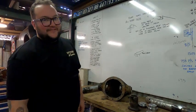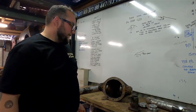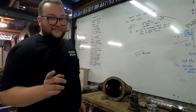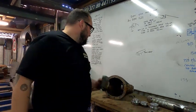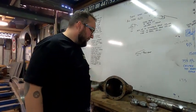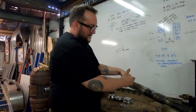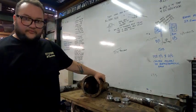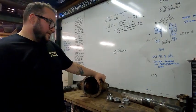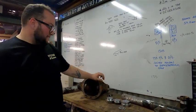He was actually going to use it as a jig to set diff width for a car. Anyway, he doesn't need it anymore. That's what he thinks anyway, so don't tell him. Well, it's not going back now. No, we've taken it off him. So it's got the axle tubes out. All we'll do now is cut the tube down, slide it back in, heat it, and redo the factory plug welds. So it'll essentially look like a really short AU Falcon diff from factory.